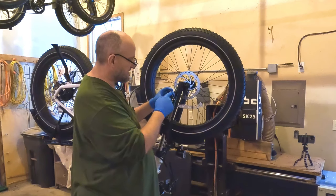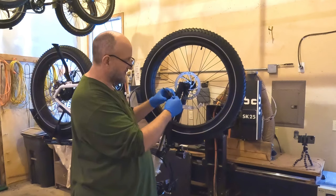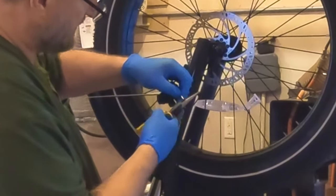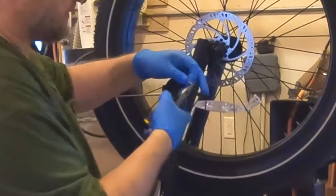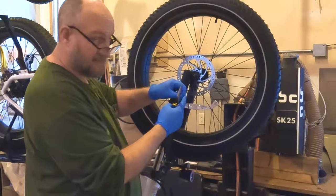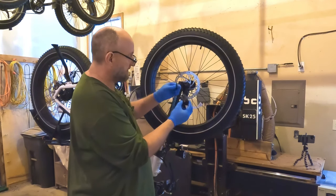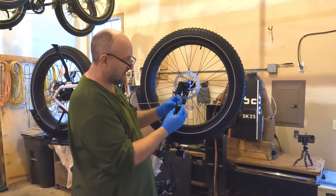Now to take off the caliper, I just loosen the bolt — I don't want to take it out all the way, I just want to make it so the cable slides back and forth. Then I'm going to take my needle-nose pliers and sometimes you can pry that off. This time I'm not going to be able to do it, so I'm just going to clip the cable and take that end off because I'm going to have to slide the cable back out through that. Make sure you keep the rubber piece in case you ever decide to use these calipers again.